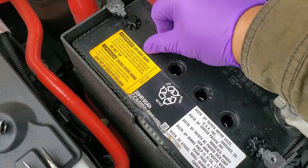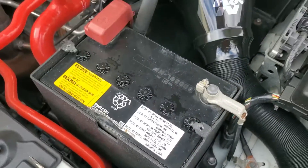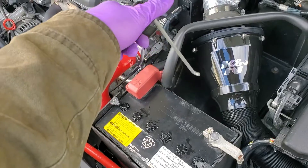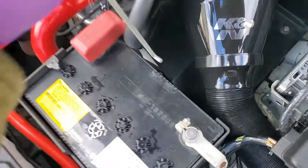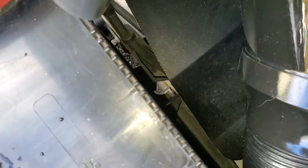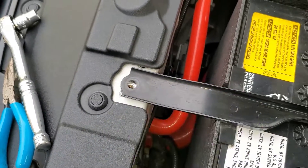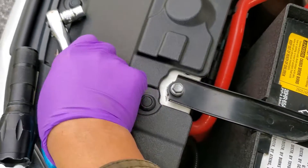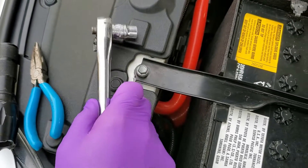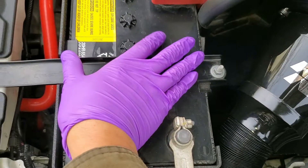Now to replace all six caps — you just need to tighten them down hand tight. Now to replace the battery tie-down. The trick for the hook is that it doesn't face towards the battery but towards the driver's side. There's a small hole for the hook to go into. I loosen the nut on top just enough so I can push the front of the tie-down flat, then replace the front bolt and screw it all the way down with the socket wrench. Once that's secure, tighten down the nut enough so you have equal clamping force on the front and back of the battery.